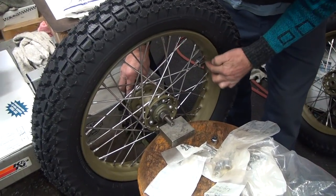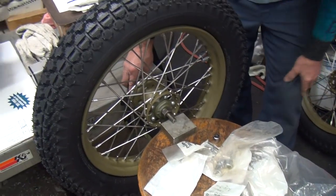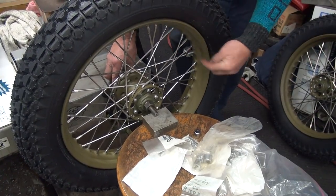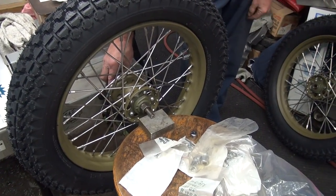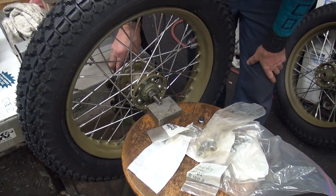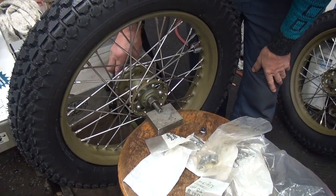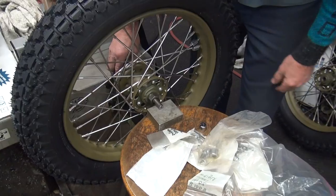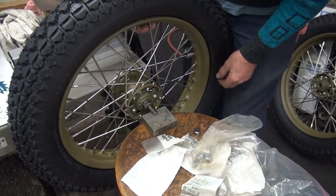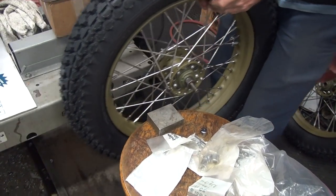So these three spokes here we're going to have to use because there's too much weight. You know, 3/4 ounce is what we had on that one, and that's pretty tall. These are 2, so it'd have to be a third more higher, we'd be right up into that spot. We don't want to do that. So I need to make three of them that are 2 ounces total. It's 25 grams to an ounce, it looked like. Or I can do it in four. I think three would be fine.